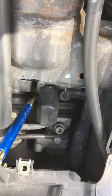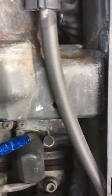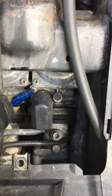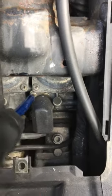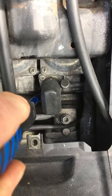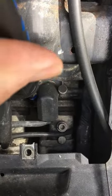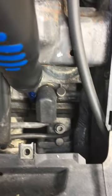By turning that clockwise — so you turn up your bike's idle speed by turning it clockwise. Wrong screw — this one's way down here. Now listen, here we go. So, idle speed clockwise: faster, faster — too fast.